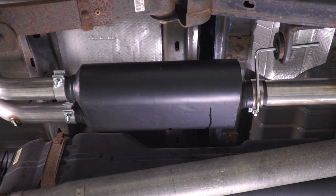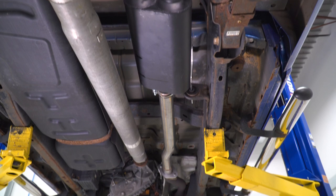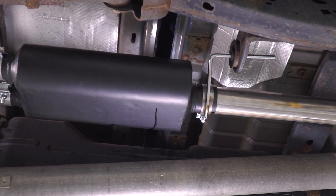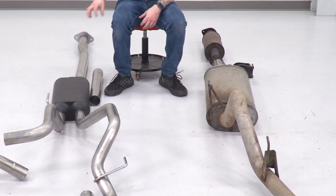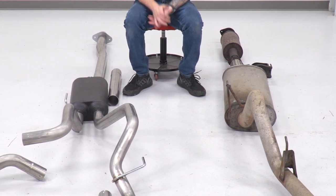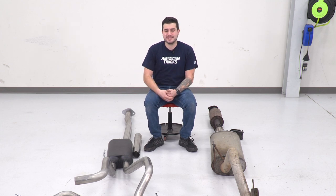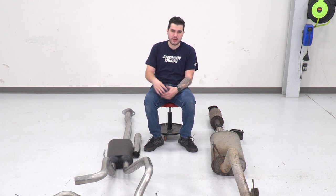Going into your muffler, it's completely different in terms of size, color, and finish. The size makes a difference, and it's a chambered muffler — not a straight-through design — so you won't get all that volume and rasp. You'll get that deep aggressive sound without being too overwhelming. The black powder-coated finish helps with corrosion and rust resistance. 409 stainless steel isn't the highest quality but it's not the cheapest either — it's that middle-of-the-road option — and the black powder coating beefs up the durability.